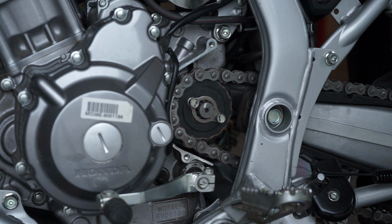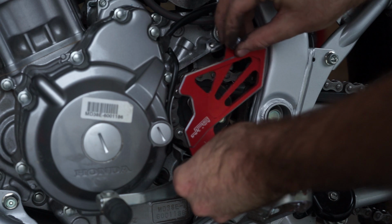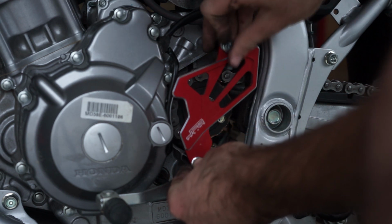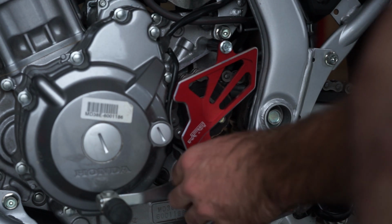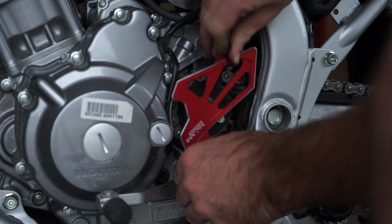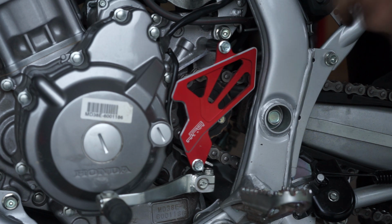Last thing you're going to want to do is put this chain guard on. This is just a safety thing. You don't really need one, and also I'm going to link the chain guard below, but this one did not come with bolts to install it onto your bike. The bolts that I bought are going to be in the description. I got them at Home Depot. They're zinc coated. I really wanted stainless steel ones, but I could not find them. But they are M6-1 millimeters, and they're 50 millimeters long. The head is 10 millimeters, which is pretty standard throughout the whole bike, so that is pretty nice.